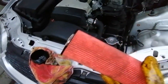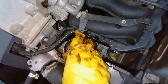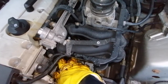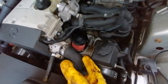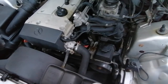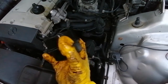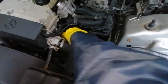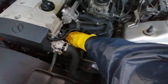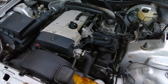I've got the filter over the bucket because it's really dripping, and you can see it's completely black — it needs to go. The new filter goes in like so and connects into that little hole. Unfortunately we can't prime this filter because it's upside down; normally I'd fill it with fresh oil first. The cap has a sealant ring supplied with the filter — we put some oil on it and place it up here, tightening it hand-tight. Really, hand-tight should be enough for a filter.